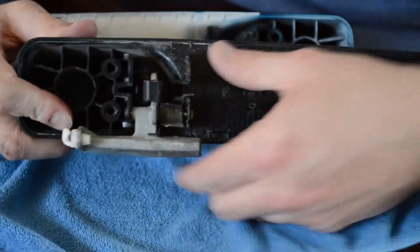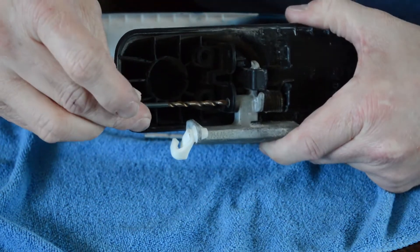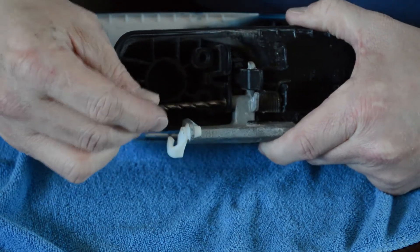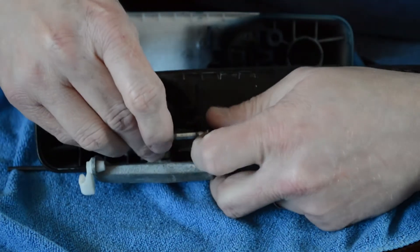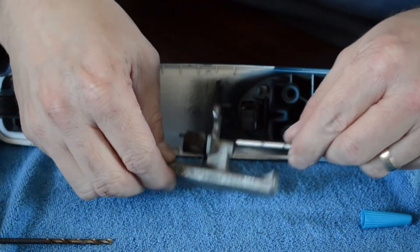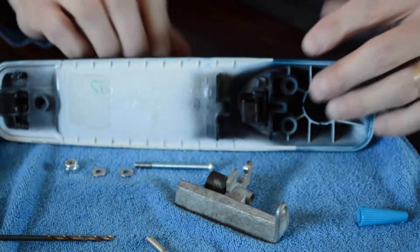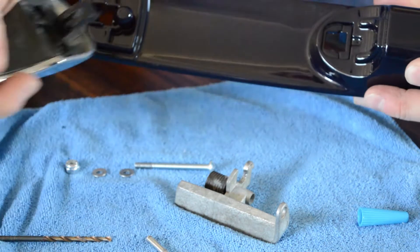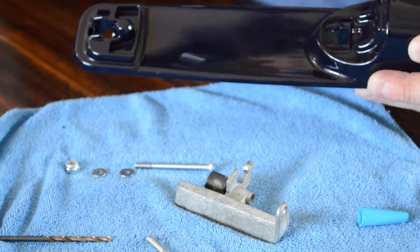I removed the door handle to show you the hinge on the back side. I got a drill bit and drilled out the beveled end that's closest to where the screws were. Once you drill this out, you can push the pin through. This piece will slide out and then it comes apart like this — you've got your spring, you've got the hinge, and then the pin's pulled out. Now that will allow you to get your back piece painted. So if you have a chrome or if you have the ones that are paintable, you will be able to take it apart and spray both.